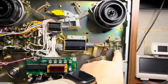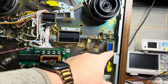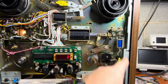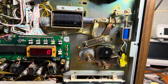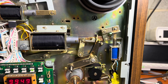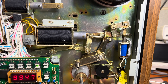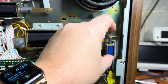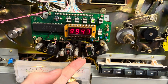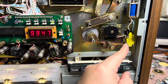Just to explain a bit more: this electromagnet gives an impulse to lock the mechanism in place for pause. When the transistor is dead it stays engaged all the time. So when I engage play, the mechanism goes down, but when I click stop it never comes fully back up because it's not releasing the magnet — and the tape guides weren't fully going down, meaning the tape was still touching the heads during fast forward and rewind.